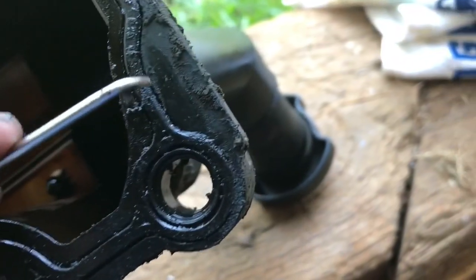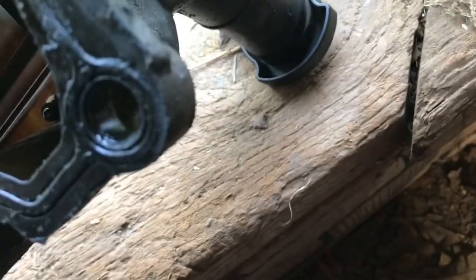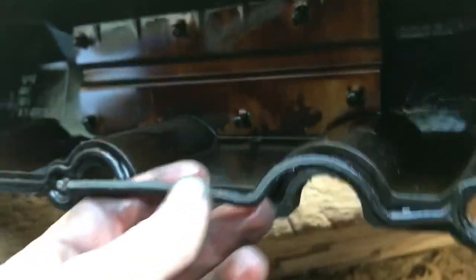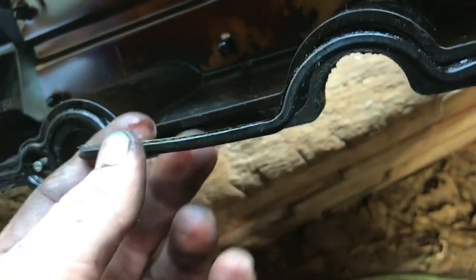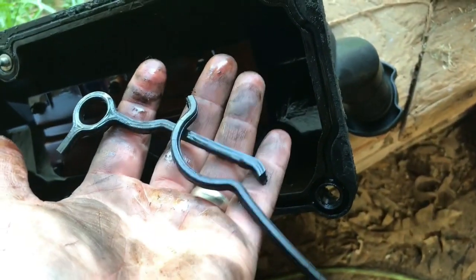Here's the valve cover off the car. The gasket is just a little silicone gasket that fits in this groove. Get yourself a little pick and start pulling it out and getting it loose. You can see how brittle it is — it's just breaking as I'm pulling it out. That's why they start leaking. That gasket should be real flexible, but if you feel it, it's real stiff, and as I bend it, it's cracking in places — it's just coming out in pieces.